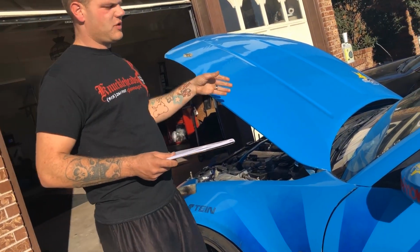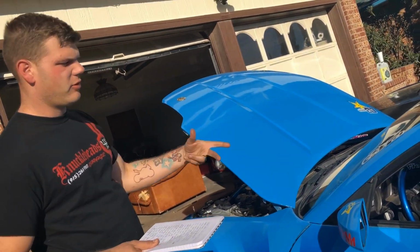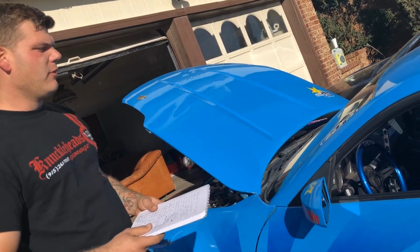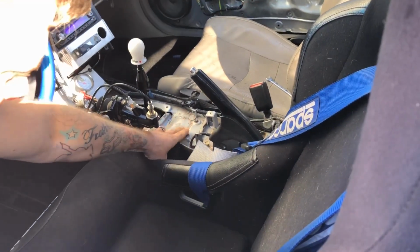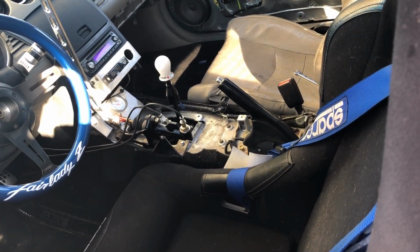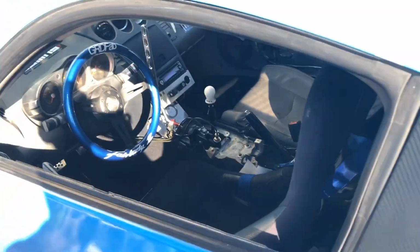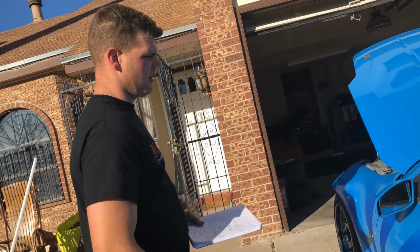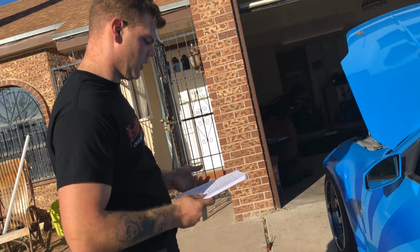So like I said, the transmission got shifted back, so to compensate for that, I bought a GK Tech shortened shifter. It's short throw, and it moves the shifter up forward about 4 inches. Normally the shifter would sit way back here, and now you can see it sits further forward, so it actually sits in the stock hole. Very nice. The lockout is really nice. It's got the reverse lockout, and the shifting just feels real crisp, and you always know you're in the gear when you want to be in the gear. There's no real confusion when it comes to that.